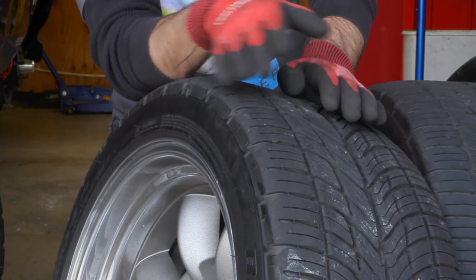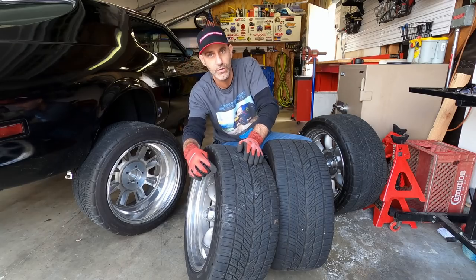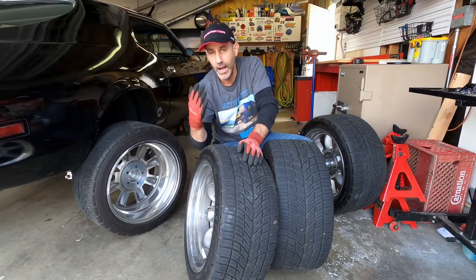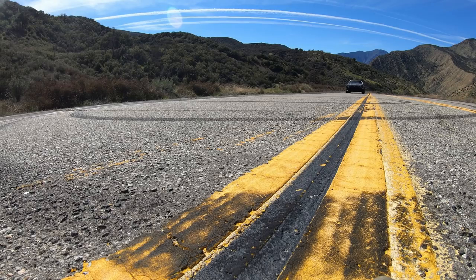It rolled the edge, just turned the corner. You don't wanna be running down here. There's no traction. It's not an off-road vehicle where you actually use the sidewall as traction. You don't wanna be down here. That's bad for your tire, and you don't get good traction. Now that's something that we'll cover in suspension stuff in a minute.